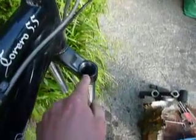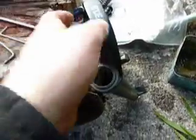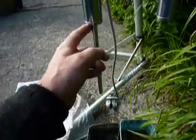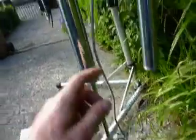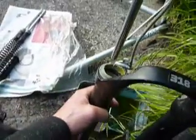In the compression leg you've also got to take the oil out, so I'll turn the fork upside down and drain that out. Given it a wipe out so it's ready to go back together. It needs 10cc of 10-weight oil in the bottom of one fork leg, 10cc of 15-weight in the other side, and then 200cc of 5-weight in the damper. Just grease the seals so that goes back on.